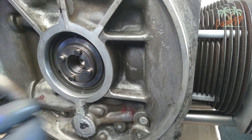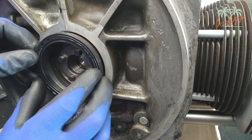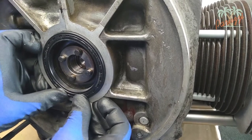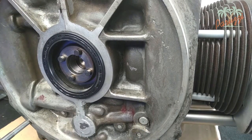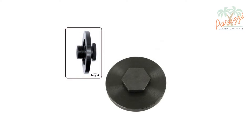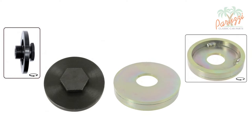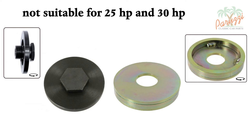Place the new crank seal in the crankcase, just enough to stay in place. Check that the seal is evenly seated all around. Use a crank seal installation tool — this special tool will ensure that the crank seal is pushed evenly and straight into the crankcase. There are two types: one for standard engines and an extra deep version for engines with longer flywheel dowel pins. We use the standard version here for our AB1300 engine.